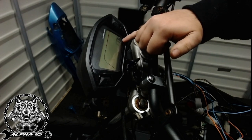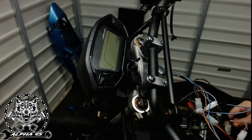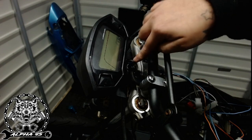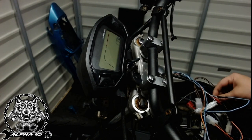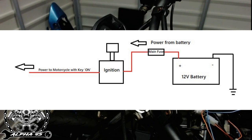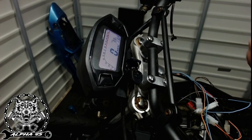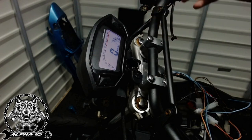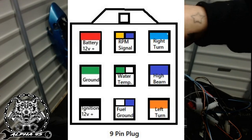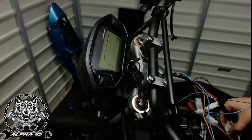So to start with, you might notice we've got the time displayed, so we do have power. The way I've done that - there's a little cable down here that goes up around to your key. On your key with this type, some of them have four cables but the same rule applies: you'll have two. One comes off the battery - as you'll understand from my previous video - and the other goes out as power out to the bike. One actually has to be hooked up to the battery permanently - that's like the memory, saving your time and settings - and then the other is the switched power, so when you turn the key it lights up.